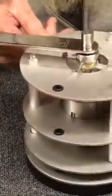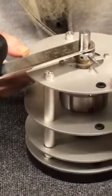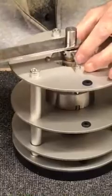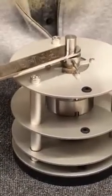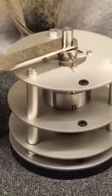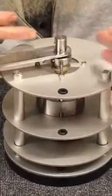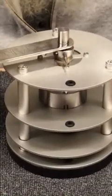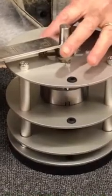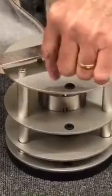Barb says move on, so I will. I've established my zero — gone down until it stops. That's my zero point. I keep going over it because it confuses people. Now, here I am. I have a clock face that I'm looking at: 12 o'clock, nine, six, three. My first espresso setting is going to be around three quarters of a turn. I go counterclockwise with the pointer, three quarters of a turn, then tighten my bolt.